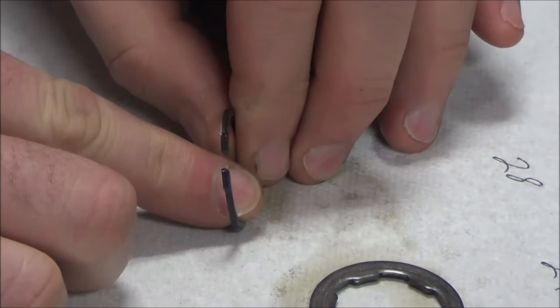Let's change directions and look at a bunch of bad stuff. This I believe was out of a Harley-Davidson, or the wide spacing makes me think it was out of an ATV or UTV. It's very obvious what the damage is — one whole piece. What do you call this type of gear? A helical gear. Okay, so we said these run quieter, you get a little better gear mesh, and they're much more expensive. This was a high-performance shaft that definitely went bang.